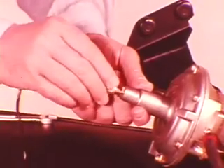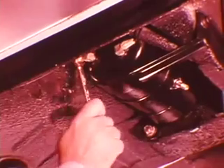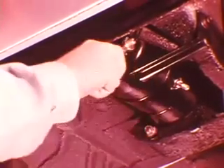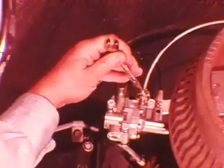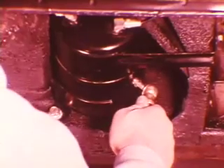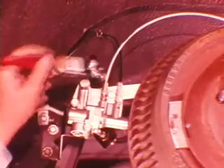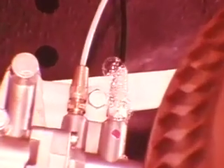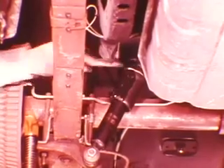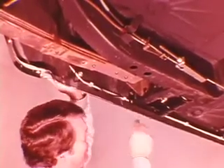Be sure the tubing is all the way into the rubber air seal and flush with the end before attaching. Tighten securely. Check the tightness of all fittings at the reserve tank, at the height control sensing valve, and, of course, the shocks. Charge the reserve tank with about 100 pounds of air pressure. If you suspect a leak in the system, apply a soapy solution to each air pressure fitting — it's possible to have a tight fitting and yet have the tubing separate or leak under high pressure. If you locate a leak, correct it before proceeding. The T-connection, other fittings, and the rubber boots at the shock absorbers should also be checked. Be sure the tubing is not kinked, does not rub against sharp edges, and all plastic clamps keep the tubing from making sharp angled bends.